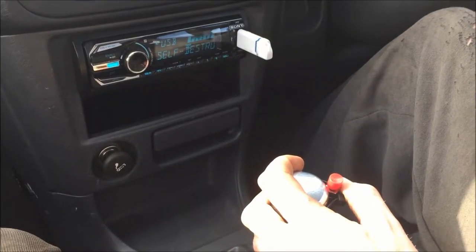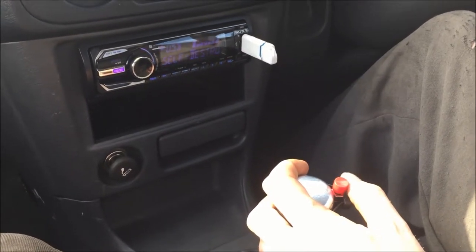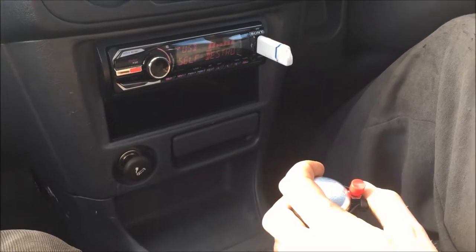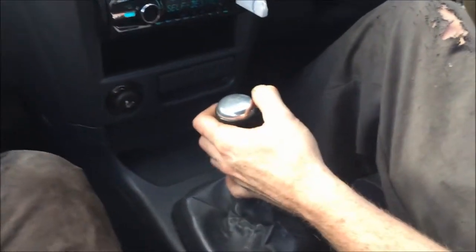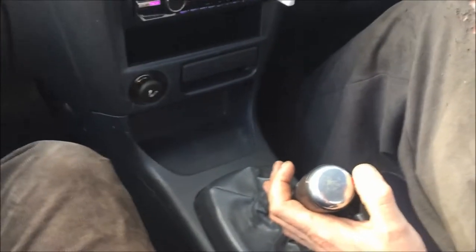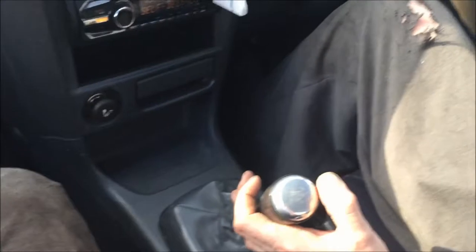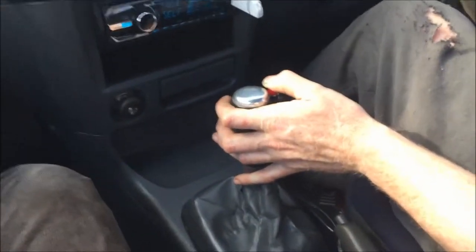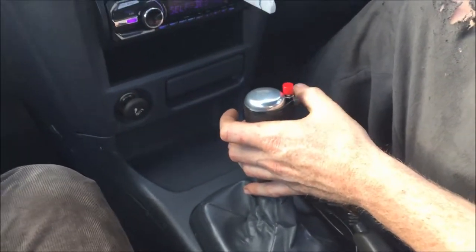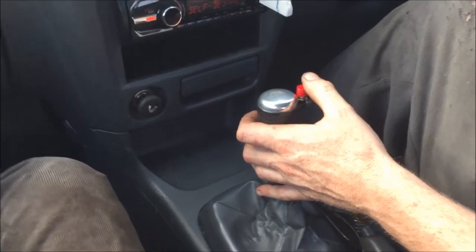All this on a little 1.5 litre with a standard camshaft — it is very small. I've rebuilt the engine twice just playing around with it, and the cam profile specs mean the actual amount of air the engine draws in is not much at all, so it's actually seen a very large increase in power from what it once was. Not to mention the engine itself has cleaned up a lot, from being a very harsh-feeling engine to being a lot smoother.